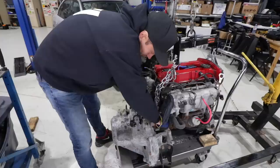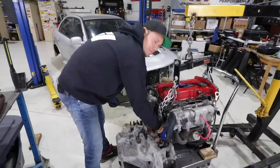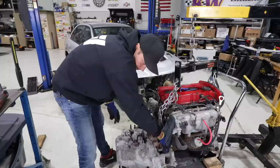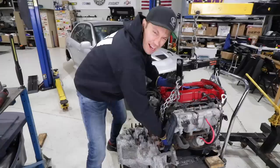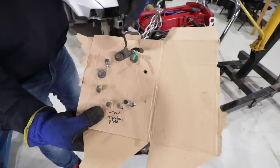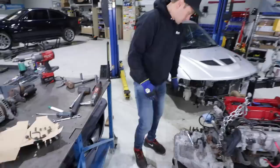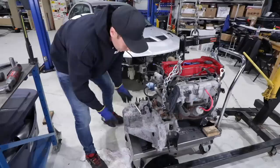We are just down to the last bolt holding the transmission to the engine block. With these, you can mix the bolts up quite easily since there are different lengths. What we usually do is take a piece of cardboard, start with one bolt at the top and work our way around, then poke them through. Now you know where your transmission bolts go. Let's see if I can just wiggle this one off, or if it's going to be a transfer case situation.